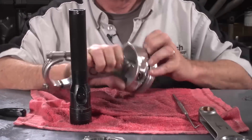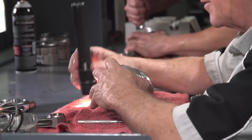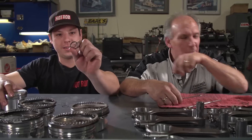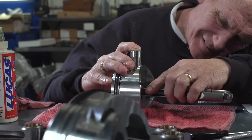One of my least favorite things to do? Put spiral locks in pistons. You know what my even less favorite thing to do is? Take them back out of the piston. We just finished swapping all of the original 5/64 ring pack pistons off of the rods, which meant a lot of these spiral locks. There's a saying in racing that pistons are from heaven and spiral locks are from hell — but they're all out. So we've got to hang the new pistons and then we'll be ready to put them back on the motor and make a second pull.